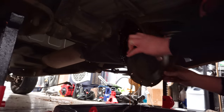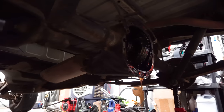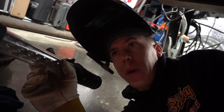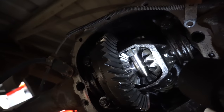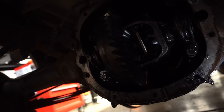Got my new fancy helmet on and getting ready to weld this up. The little bolt that holds the pin into the rear end did not come out - Alex manned it and now it's all rounded out. So I said screw it, we'll just weld it in here. I've taken some time to clean the teeth right up in there and I'm gonna try to weld up right there, then weld up each of the little corners, get them tacked together, and then probably build a plate that goes in there and welds all the teeth together.